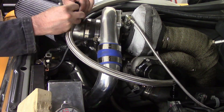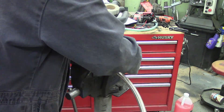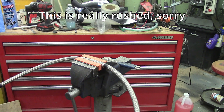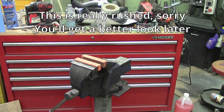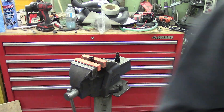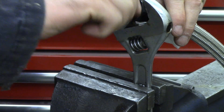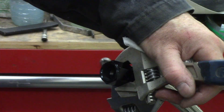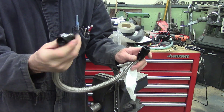So this is my first setup on the ventilation system. I use some dash 10 AN fittings — quite enjoyable. I use a bit of electrical tape to figure out where to make the cut, a 16th cutting disc, and then I use the AN fittings. One is already done — I just shoved that in, make sure it's shoved all the way in, a little bit of oil, screw it all together. I poorly placed the camera in this shot, so I'll show you another one later on.